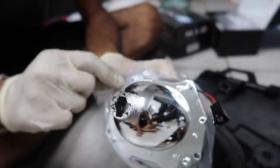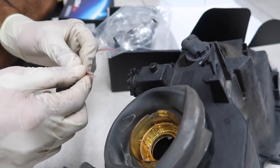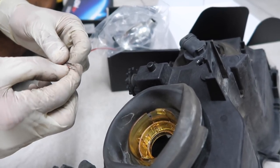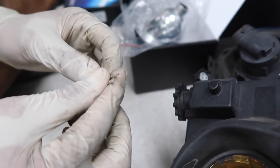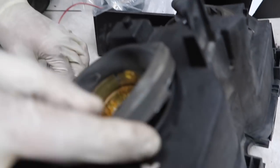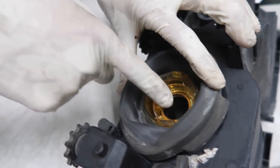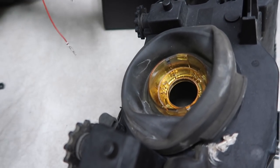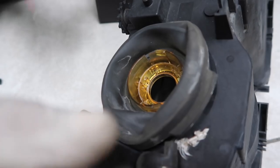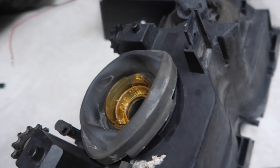Get your projector and find which side says 'top.' If you want to use the bi-xenon function, you have this wire and connector. I went in to pull the little pins out of the connector by pressing in the tab with a flathead. I'm going to drill a small hole at the bottom of the bowl and pass these wires through it so the projector can still sit properly flush in the hole. Many people slide it through the main opening, but that doesn't let the projector sit perfectly flush. Drilling the hole at the bottom works because the wire comes out at the bottom.